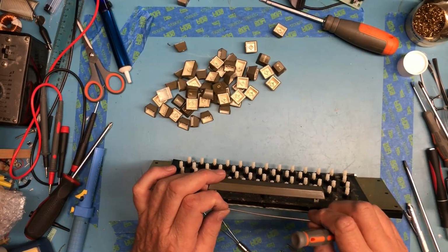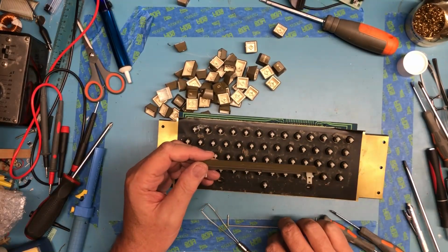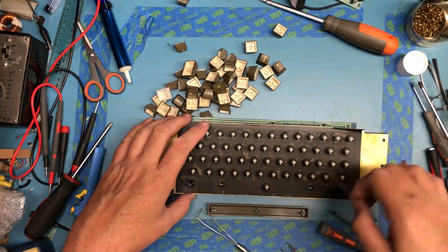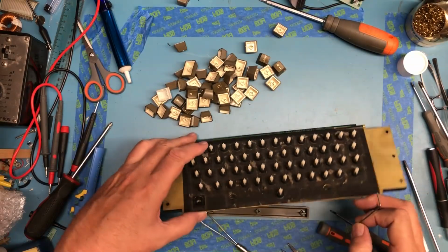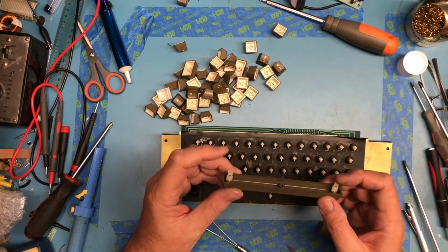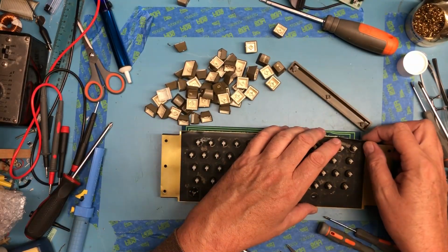Okay, that makes sense. It's different from any mechanism I've ever seen on any other keyboard, but it makes perfect sense. The return spring for it drops into place, and then the bar drops in through the holes here and just catches in these three little catches to hold it in place. So actually not a bad little design, but again, you don't want to break these nylon connectors here, because putting that back together could be rather rough.